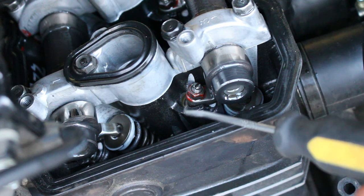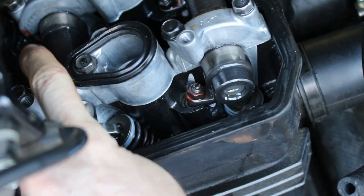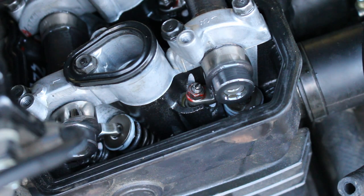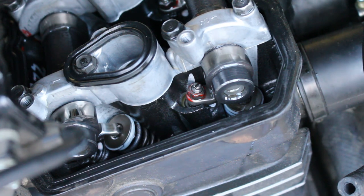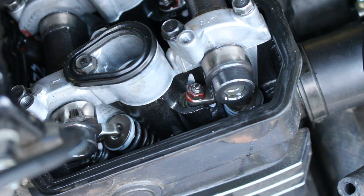So I've already loosened this backside here, the inside exhaust valve was a little bit tight. I really had to force the 5 thousandths inch in there. And so now I'm going to just ever so slightly loosen it. It does say if you're adjusting the valves that you're supposed to remove the radiator and stuff, but I'm gonna try to avoid that if possible.